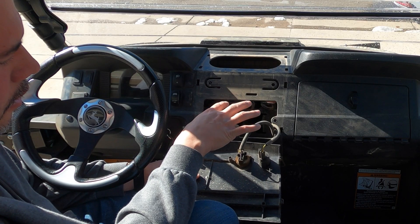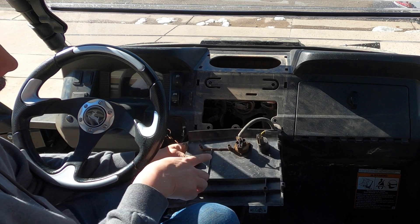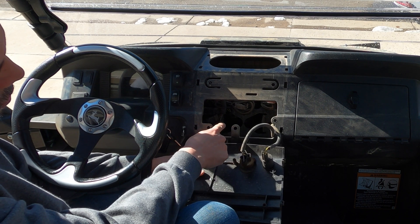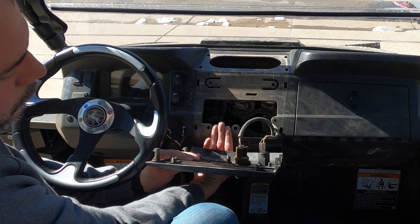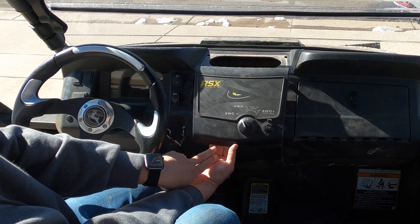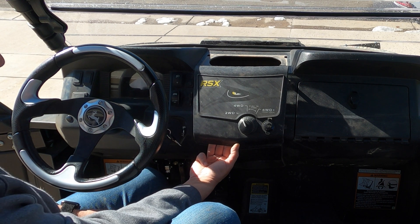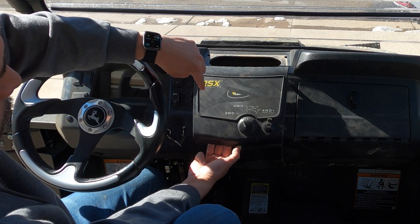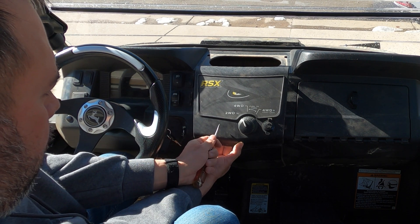Now that I have this open we can see where everything's at. I want to put the gauge here, but looking at the back we've got these little pegs that stick out and go into holes — I don't want to drill through those pegs. So by putting the panel up and using my fingers as a marker from below, I can confirm it needs to be in this area. I'm going to drill a one-inch hole, put the plastic back and snap it in place to hold it while drilling, then mark the center of the hole.